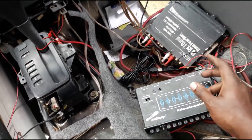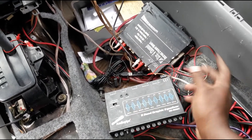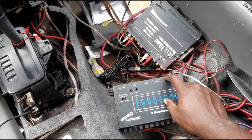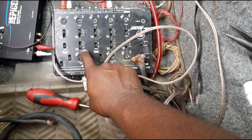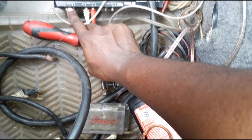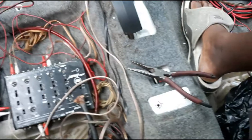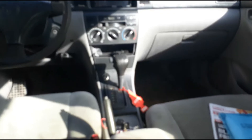So what you could do like what I do: from the radio, say for example tweeters, bring it from here — and then I take it from that same jack and I don't bring it to the amp right away. I bring it to the crossover first so everything can be clean before you go to the amp. Then from here — this is the heights — it goes to the exit for your tweeters, and then from there to your amp. Vice versa for everything else.